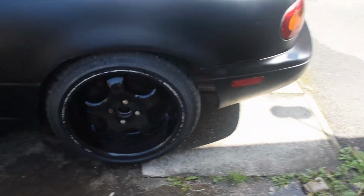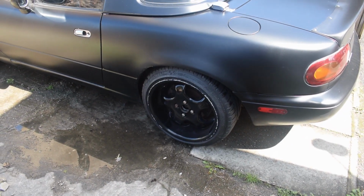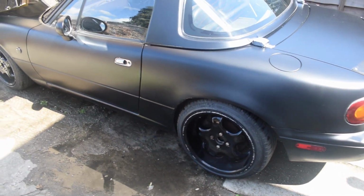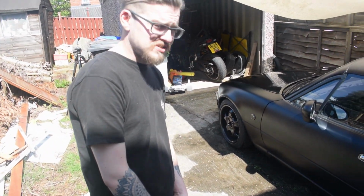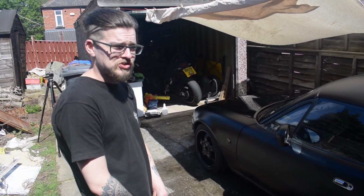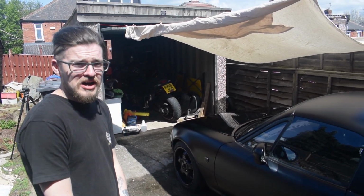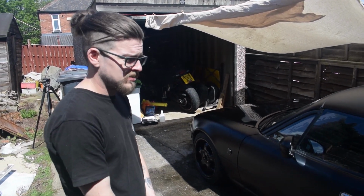Yeah. They are wide boys on the back. They are fitted with 15mm Derenza spacers for clearance. I also rolled the arches. I've never done that before. I bought an eBay £30 arch roller. It didn't fit under the arch wells at all, so I ended up tapping the whole arches.